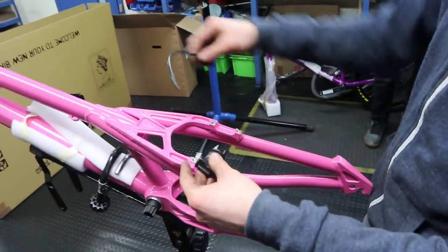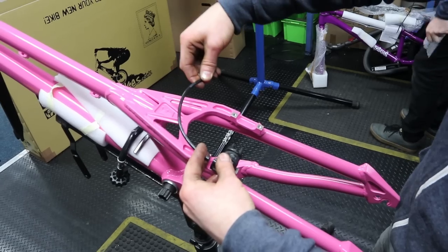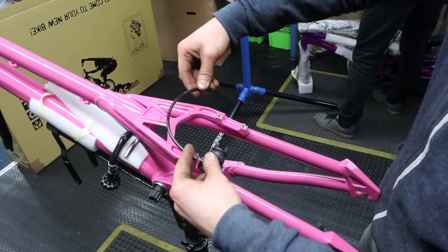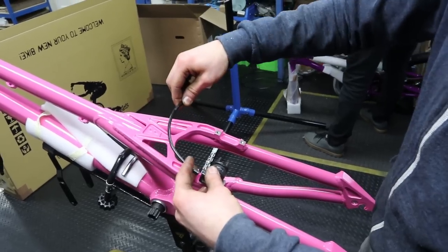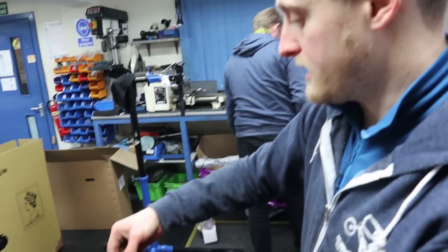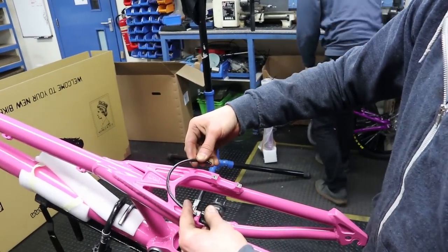When you've got a really wide rim the cylinders are pushed out quite far, and if you've got a standard length crossover it's got to be pulled in really tight. So we're going to go a bit longer to give it some bow. That crossover was a little bit shorter than normal anyway, so we'll add about three or four centimeters to give you much more ease on the brakes as well.